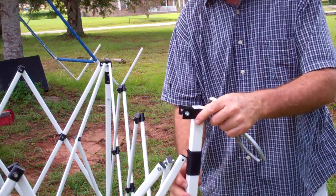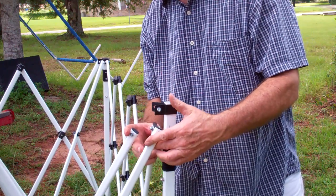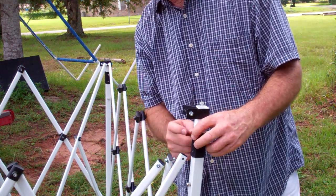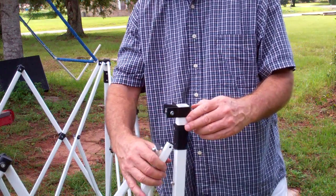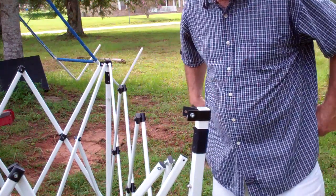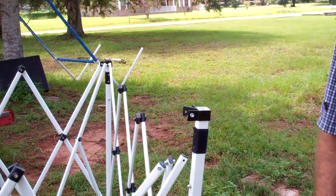The button's in. Now all I have to do is put these two screws back in here, connect these three arms, put the cap in, and put the two screws there. Actually the correct order is: put these two screws on first, then put the cap in, put the two screws to hold the cap in, then put the arms on. If you get lost, just look at the other top corner to see how it's done. Hopefully you can save a canopy and save some money. Thanks for watching.